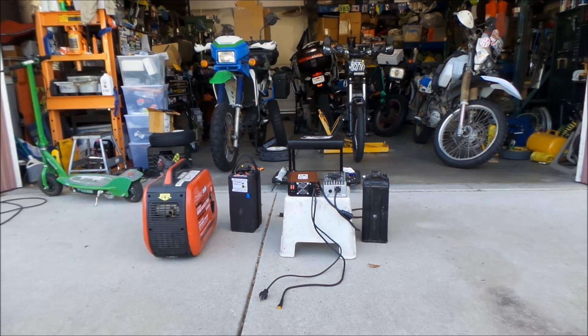This generator is almost three times the power of that 750-watt inverter, so hopefully this one will fare a little better. For the second test, we'll try to charge with both chargers at the same time. We're going to dial the current all the way down on the Lightspeed battery charger, plug the Suron charger in, and see how many amps we can push before the generator gives out. All right, let's go fire this generator.